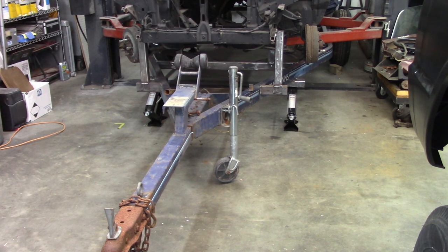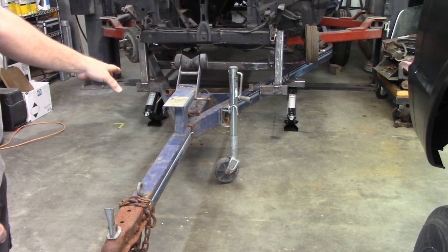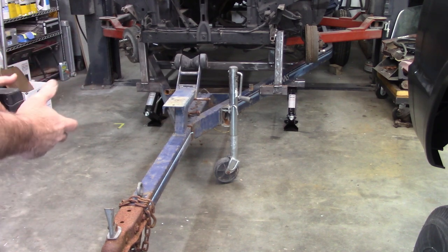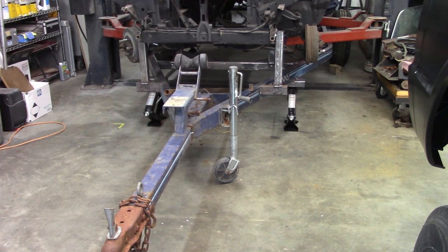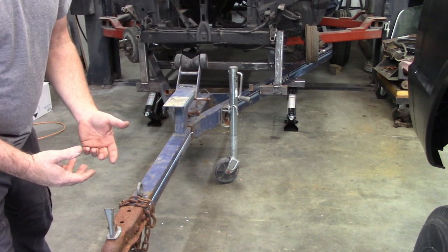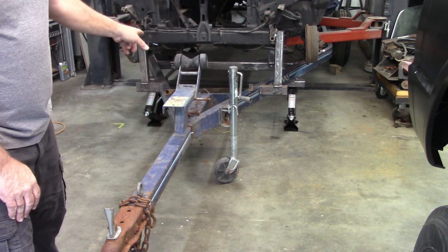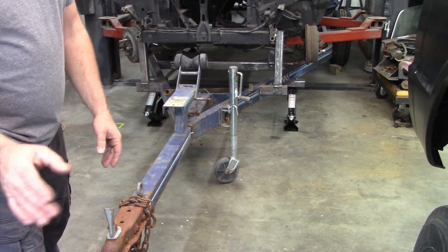This is a solid two-by-four square tubing frame and I have welded jacks — two in the front and two in the back. Currently all the weight of the trailer is on the jacks, and even though the car is attached, the weight of the car is on the lift. What I was trying to consider is the idea of being able to lift this and move the trailer assembly around. If I try to lift at the front, I'm technically lifting the trailer at the rear mount points, putting all the weight all the way at the back of the trailer.